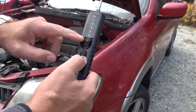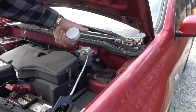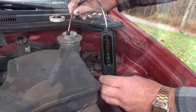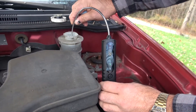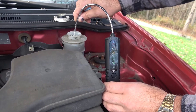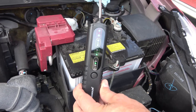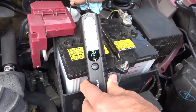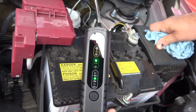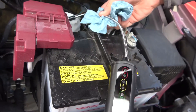We have our choices here: DOT 3, DOT 4, DOT 5.1. This first car takes DOT 3, so I'll set it to DOT 3, go ahead and dip it in — and it's giving us a caution. The contaminant level is just at the beginning of being a problem. On the next car, which takes DOT 4, it's a slightly newer car. Stick that in there — and as I expected, being that it has very few miles and years on it, this one is testing OK. So far it's reading fairly accurate. Let's go check out the 40-year-old car.